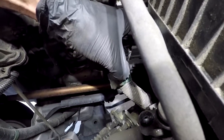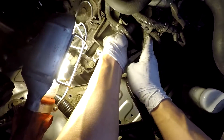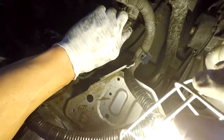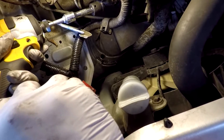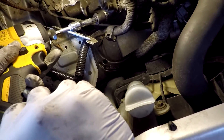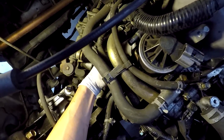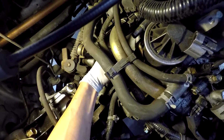Push that and you can get it out, and then you can finally get to the starter. The starter is actually only two bolts. First, take off this ground piece, and then there's one nut that gives the starter electricity — take that nut off. There's one easier bolt and then there's another one on the lower side of the starter which is harder to get to.